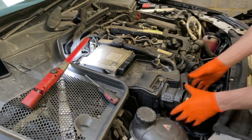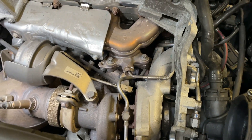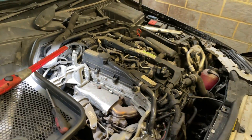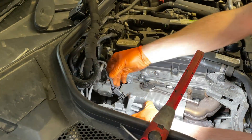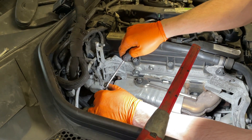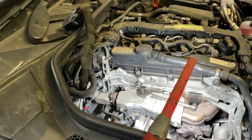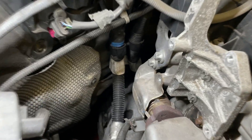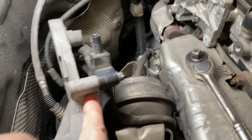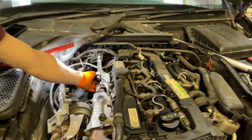The airbox also has to be removed to have more clearance. Here we have the turbos — this is a twin turbo engine. We are making a bit of room on this side where the timing chain tensioner is located. We need to strip this housing that hosts the airbox, and this is the particulate filter pressure sensor. There's another bracket that we'll have to remove to get some access to the tensioner.